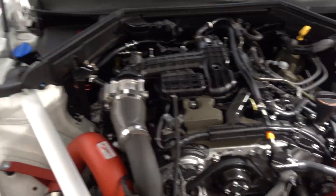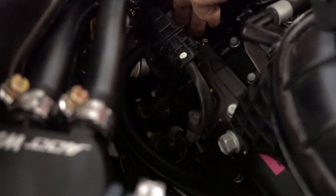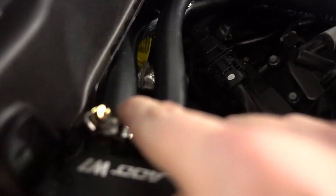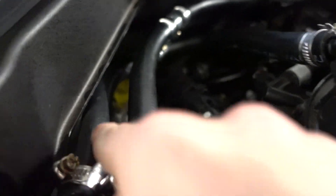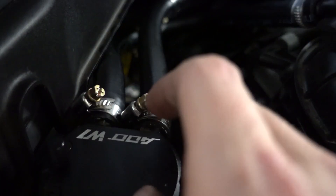The way I routed this was of course coming off of the PCV valve. This line connects in the very back, and then the outlet line comes down through a one-way check valve pointing away from the can, and then comes up into the intake. The other line is where I was having issues because I have the engine intakes and they have the intake outlet in a different place.